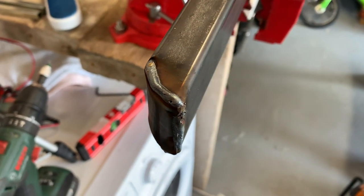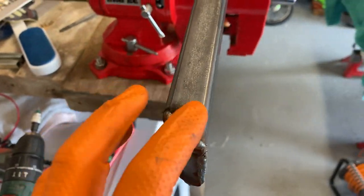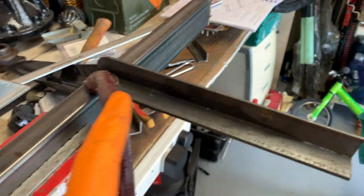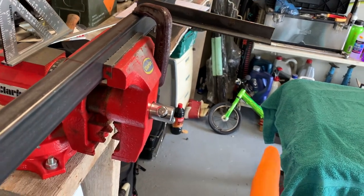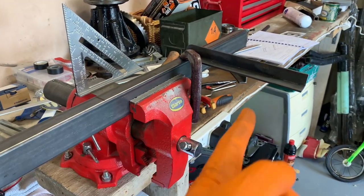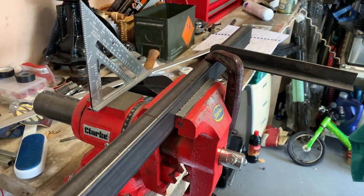Before I go any further, this is my welding - I'm showing the nice tidy side of course. The other side maybe isn't so pretty but came in okay. I'm going to grind these nice and flat and tidy the whole thing up to make it a bit more presentable. I've moved on to clamping up the brackets - you have to imagine the bumper is upside down now. These brackets are going to screw into the bottom of the floor of the Toylander, because this is quite a weighty piece of steel and the wooden supports wouldn't really cut the mustard. Heavy bumper, nice steel supports, screw them into the floor - two of these need to be welded on.